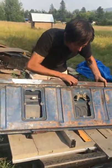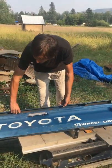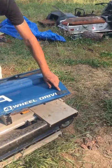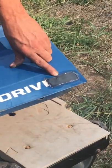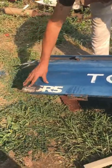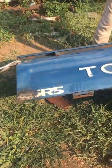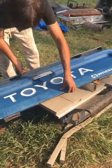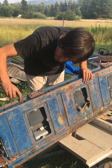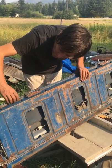So that was one problem that I've been working on. The other one is I had rust holes here, and you can see I've got the patch cut and pre-fitted, and then here's the side that I've welded in. I have yet to grind and sand it down. Then I'm going to put a patch in this side, and on this side here I ran into a bit of rust, so I'm going to end up cutting this bottom piece of metal out and welding a new one in.